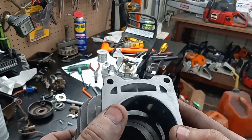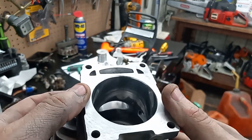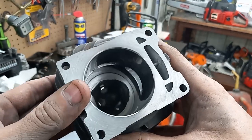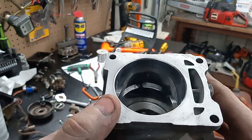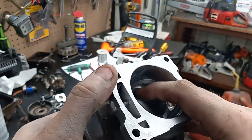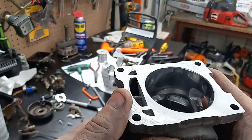There's the lower work — not much I could do in there, pretty much textured it. The base is cut, it's about 55 thousandths off the base. The chamber's cut on the same taper as the piston. There is the upper transfer work — I fired the secondary two degrees before the primary.